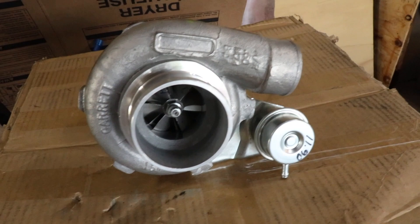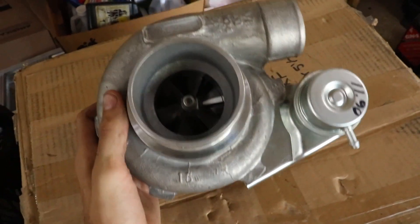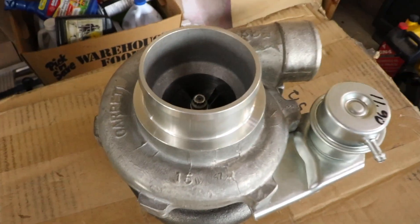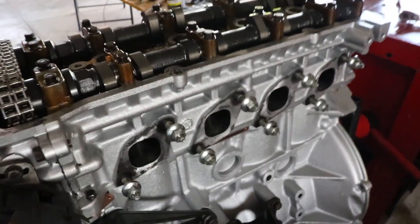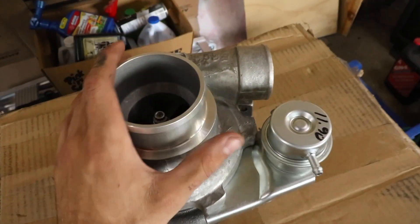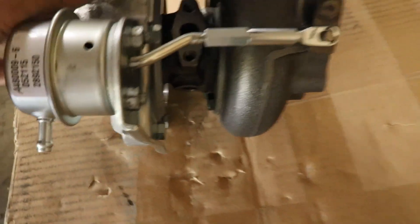It's always a good day when you get one of these boxes. So here's my turbo - this is a Garrett GT2871R, 56 trim, .86 AR. The reason I went with that is because I don't really want to come up short on my power goals. I'm building my whole setup to sacrifice a little bit of spool for the potential to make more power. With the 1.2 millimeter head gasket I'm running a little less compression, which makes it easier to tune and will make more power but won't spool as fast. I also got the bigger housing.